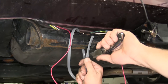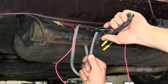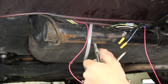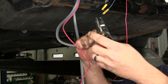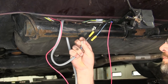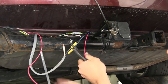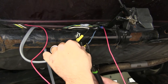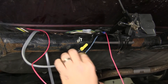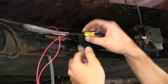Next we'll take the gray duplex cable from our install kit, strip back the gray jacketing, and then strip back both wires. We'll connect black to black and white to blue — the butt connectors are already on the seven pole side. Now with all our connections made, we'll go ahead and wrap it back up with some black electrical tape to help keep it free from dirt, dust, debris, and moisture.